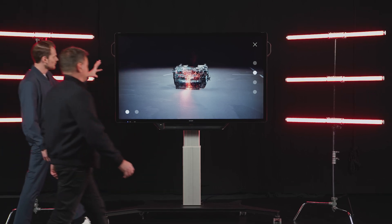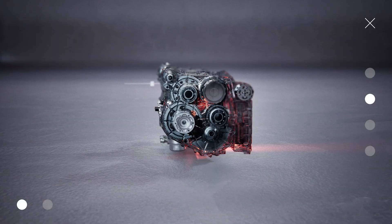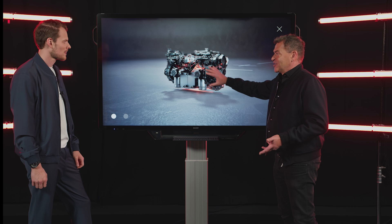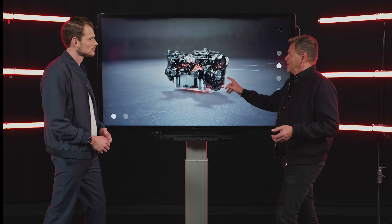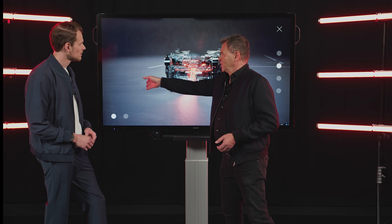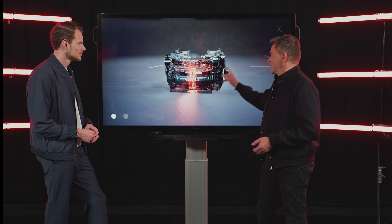This is a more detailed version of the powertrain — but that's just a part of it. The powertrain in an electric vehicle is defined by the battery, transmission, and electric motor, which together form the drivetrain. With an electric drivetrain, you can do very cool things. Think of it this way: here's the left wheel and here's the right wheel — rear-axle driven, the beast, so to speak. Each of these motors has a capability of 500 horsepower each, and one is linked to the left and one is linked to the right wheel. So it's a real individual drivetrain.